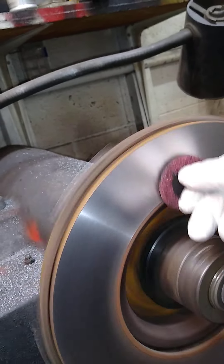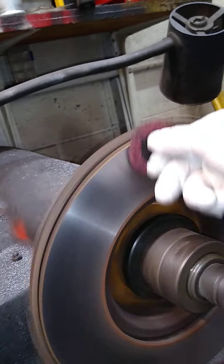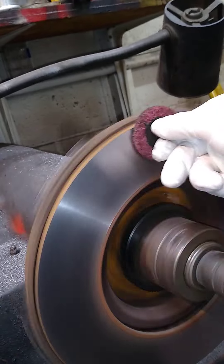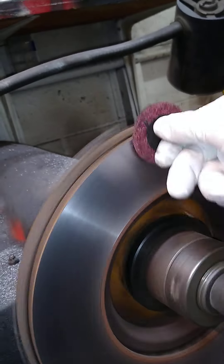That process involves a few higher speed stops, some low speed stops, and some mid-stops — usually good for the mechanic to bed everything in. Then the customer definitely needs to drive easy for 500 to 1,000 miles after this, because the rotor will really get hot and overheat fast. Same with the friction material during its curing process.